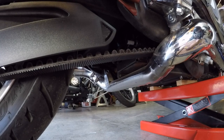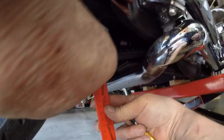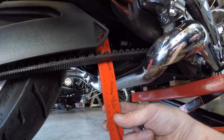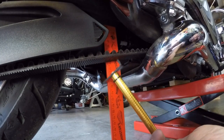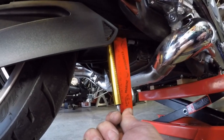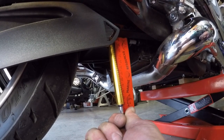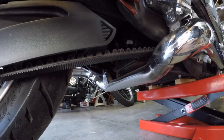Let's check it one more time. Setting the ruler at 230 millimeters right at the bottom of the belt — that's height above the floor. Pushing the gauge up to the 10-pound line: we're at 274 millimeters. So 274 minus 230 is 44 millimeters — we're about 11 millimeters too loose. The belt needs to be tightened.